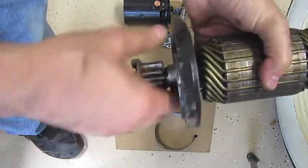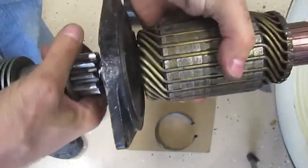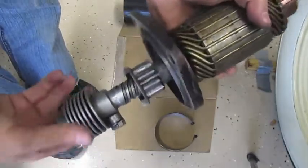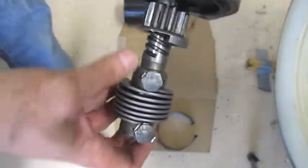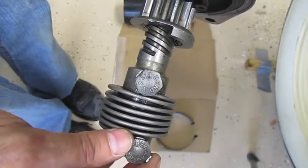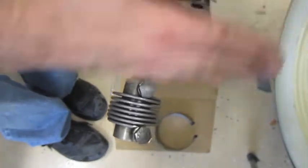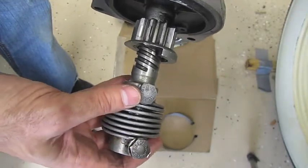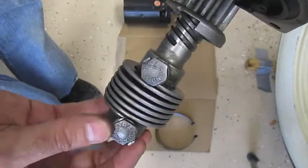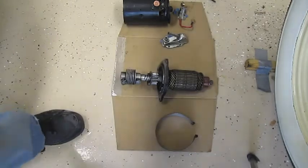If you want to comprehensively test the starter motor, you take the drive out, hook up the battery to it, and test that it spins. The important thing on the Bendix drive: you'll see two nuts at the top — you want to make sure these tabs are bent around both nuts to hold them in place. You don't want them to loosen and fall off inside your bell housing. That'd be very bad.